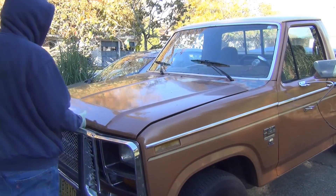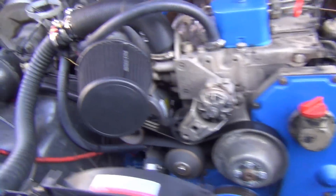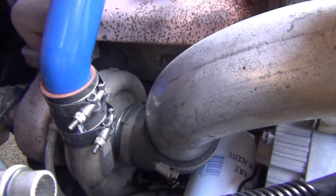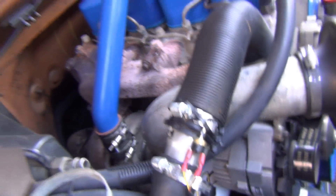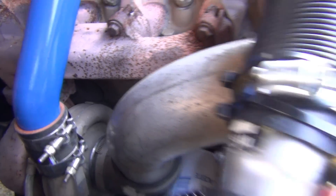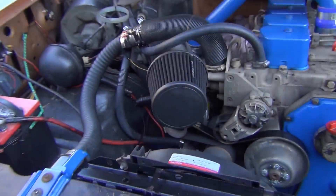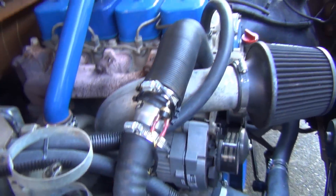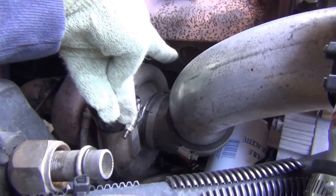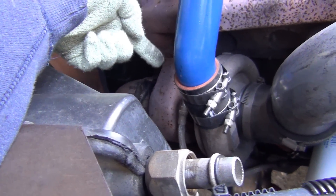It's really not all that cold temp-wise — it's like 40-something right now, but we got some wind. My engine block just has that tiny one there. However, on the other side here, we have numerous freeze plugs. They say not to run this near turbocharger systems, but I have no option but to do that. So we'll have to make a shield over there — I'm hoping it doesn't kill this thing. That's our first issue already. What we're going to have to do is get this air tube out of the way. And I don't really feel like removing my turbo at the moment — that's just going to be a whole lot of pain in the butt.